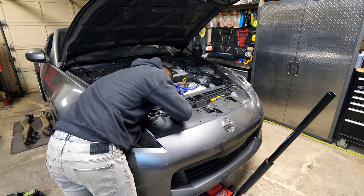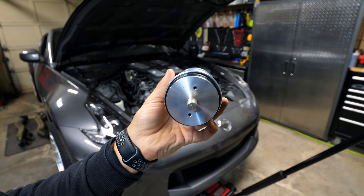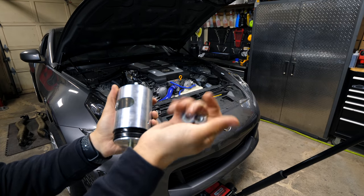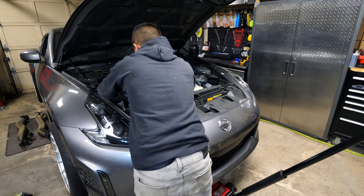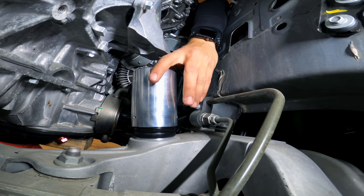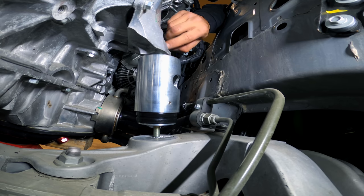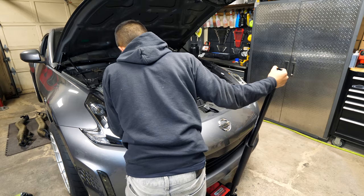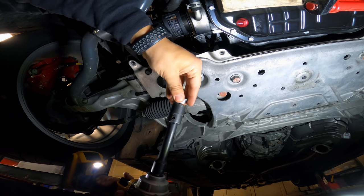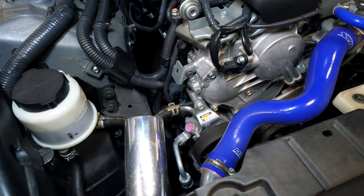Here's what the old engine mount looks like — thick, heavy rubber. The upgrade is thin, light polyurethane — much better. With the new mount and both nuts, you can set the mount into place from up top since it has a smaller profile and fits between the cylinder head and the frame. I found it easiest to rest the engine mount on top of the subframe with the top threads protruding through the engine mount bracket, thread the nut on, then lower the engine off the jack so the lower threads fall through into the subframe and you can thread the lower nut.